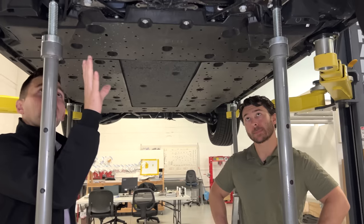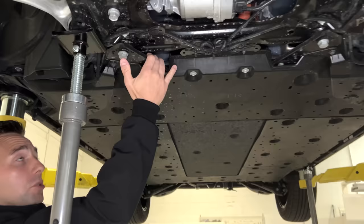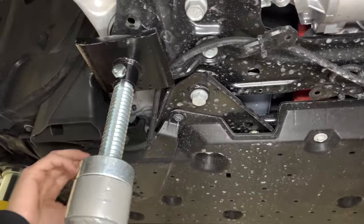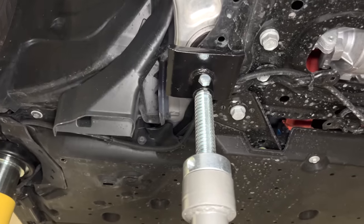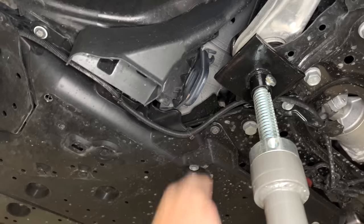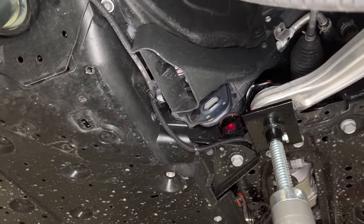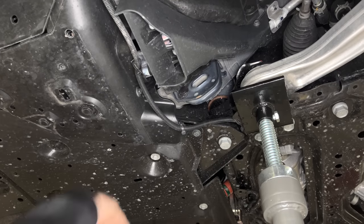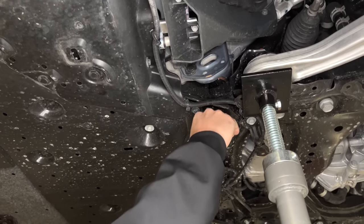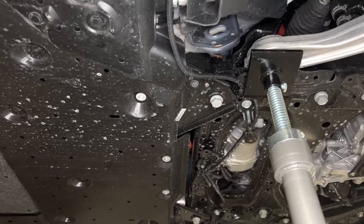And the last thing before we head over to the battery pack are these double shear brackets. We call them double shear because it's reinforcing the attachment of the cradle to the body structure on two separate planes. One structural connection is at the top of the cradle where it interfaces with the body, which is going to be hard to see, but it's right above where the laser is showing right now. That's one structural plane. And then the other structural plane, enabled by this stamped bracket, is right here at the bottom of the cradle. And so it really stabilizes and stiffens that whole joint.